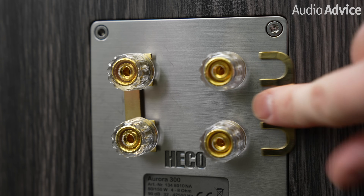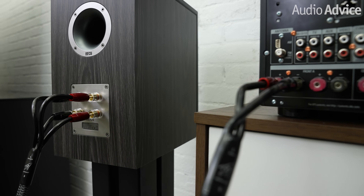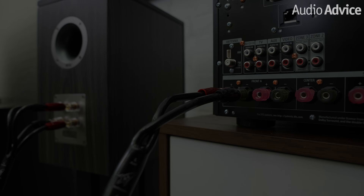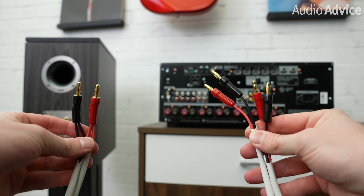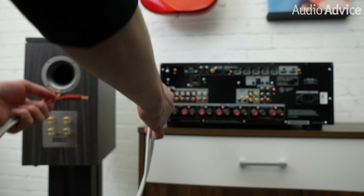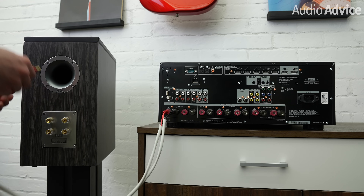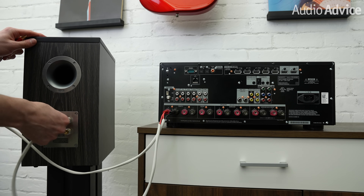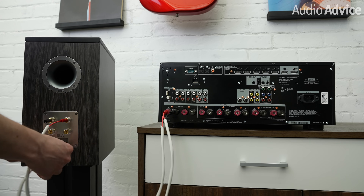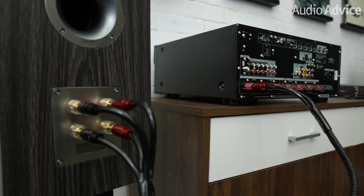To bi-wire your speakers, first remove those jumpers and use two sets of speaker cables. At the speaker end they will separate, and at your receiver or amplifier end they will typically be joined together. Some higher-performance amplifiers even have two sets of speaker connections to make it easier. It is important that you use identical cables — the same brand, model, and the exact same length. Here we have taken some basic speaker cable and modified it to be bi-wired by combining the amp end and separating the cables at the speaker end. Make sure all connections are solid and tight, and confirm that positive is not touching the negative side in any way. Even a tiny stray strand of bare wire touching the wrong terminal can eventually damage and blow up your amp. Using wire that is properly pre-terminated is your best bet. This is an example of some pre-terminated AudioQuest cable that was purposely built for bi-wiring.